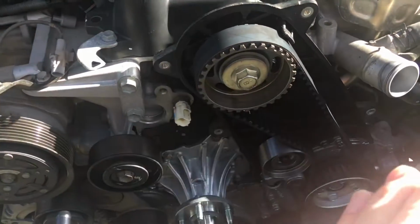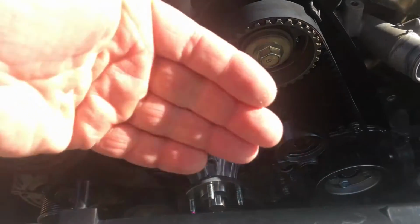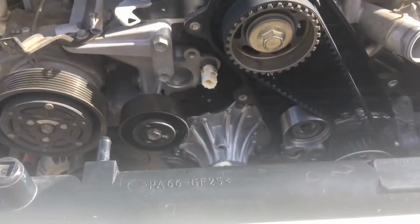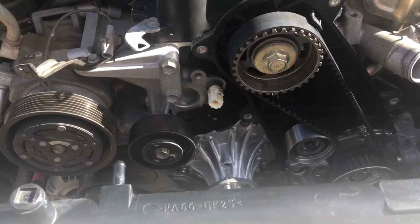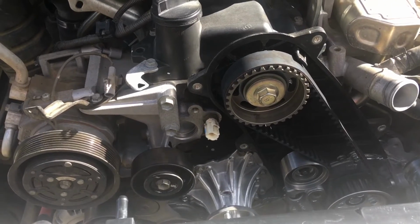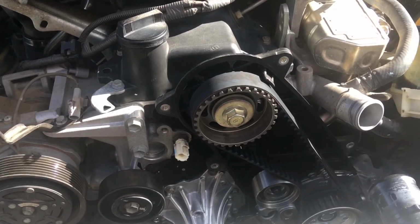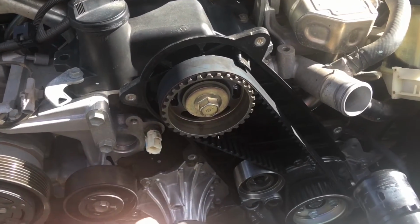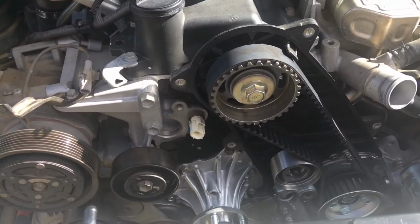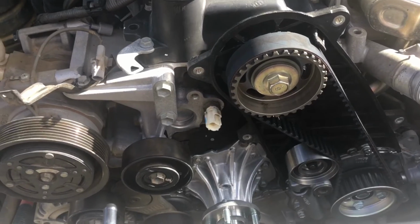So while everything's off, we put the new water pump on so that we don't wash rubbish into the engine. Then we give this radiator here a good flush, pushing all that gunk forward. It can be either really clean in a few minutes, or we can be there for half an hour and there's still dirt and debris coming out. So we spend whatever time it takes to get that, basically what I do on my own vehicle, till I'm happy. The water pump's in obviously to stop all those debris, but we don't want dirt and debris and bugs and bees and wasps and moths and whatever in your engine block. Not that it would matter, but we don't want that.